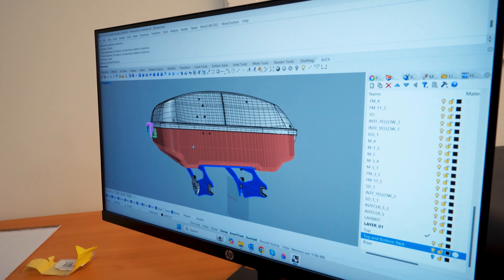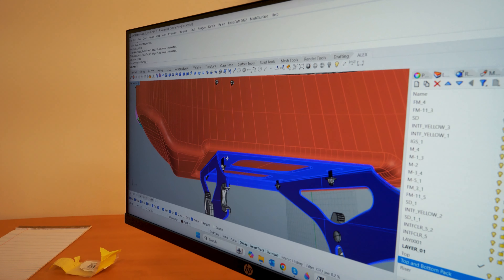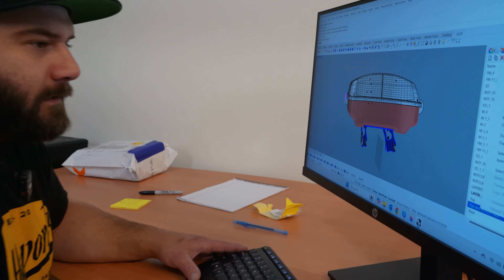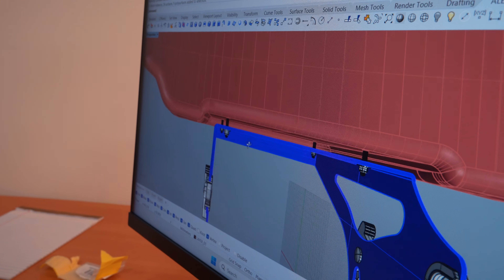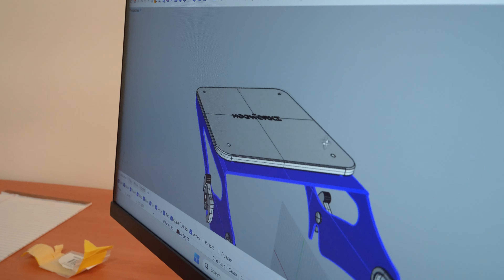So here is our tour pack, and I think if we just put a riser in between here it doesn't really have to come up a whole lot. It's only hitting by like a quarter of an inch. So I'm thinking all it needs is to be lifted up maybe a half of an inch. Let's see where that would get us — move that up about a half inch. Oh look at that, a half inch riser plate.